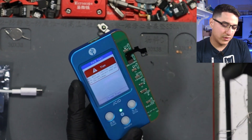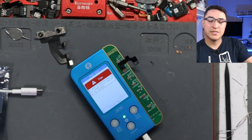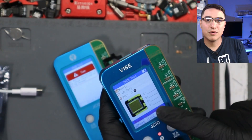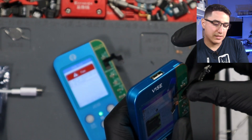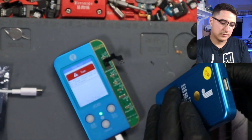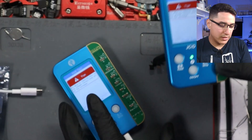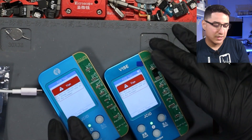I couldn't downgrade it with the JC Repair Assistant software, so we figured maybe I had a bad batch of cables. Wholesale Gadget Parts did a swap — I sent back my bad cables, they sent me their tested ones which they said worked. Same thing. Every single cable failed. We thought maybe the module itself was bad, so I bought another programmer — a V1SE. They sent me an extra one to swap out. Same result: read it, it says bin one saved, plug in the replacement JC flex, burn — exact same issue. I tried at least six different dot projector cables from different batches. Nothing.